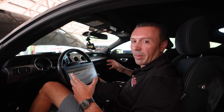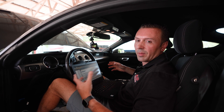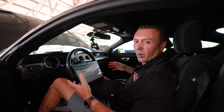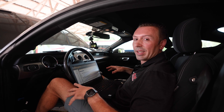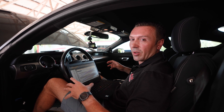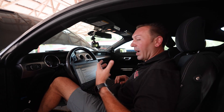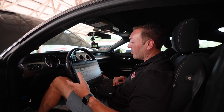Odin Level 2 is normally going to make anywhere from 680 to 720 at the wheels. You've got some differences as far as auto versus manual — manuals are always going to dyno a little bit higher. This car has entirely stock exhaust and good quality 93 pump gas from a local station we use. So I believe this is a pretty middle of the road number, the 697 rear wheel horsepower number.